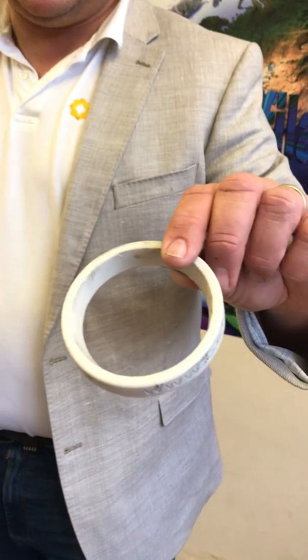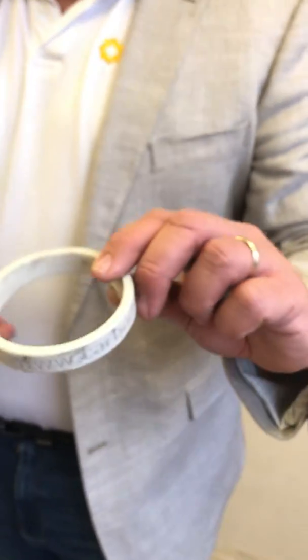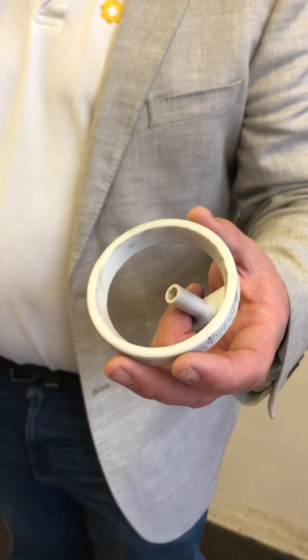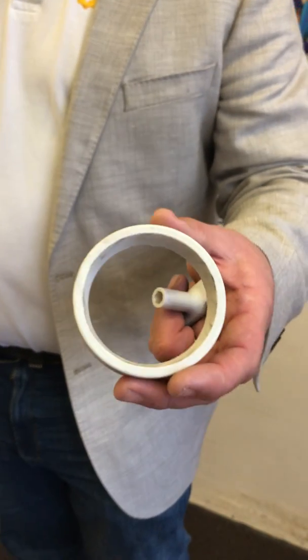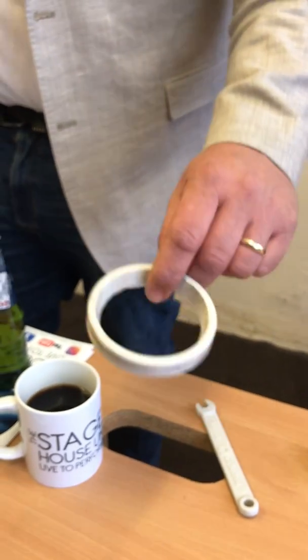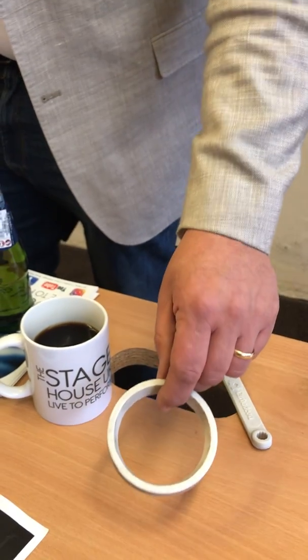This is actually a radiused inlet piece going in the intake behind the throttle. It's been trial fitted but hasn't been run — and this has been annealed. That's quite challenging for the material because on shutdown that part of the engine will get up to at least 100 degrees. There's no force on it, but you still don't really want it melted inside the engine. I actually anneal it in my wife's oven — 110 degrees for at least an hour is good enough. And not much shrinkage with that.